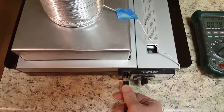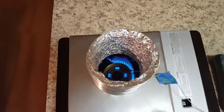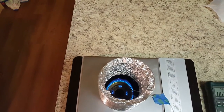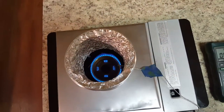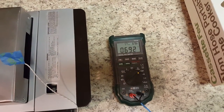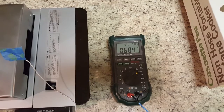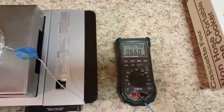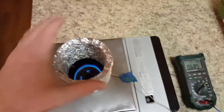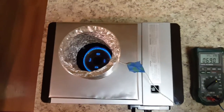The switch is down and the bottle's in. All we do is just turn it on — you can see it starts up and running — then turn it to low. On low, the temperature's coming down. When I started it on high, it went up to about 800 degrees Fahrenheit. Now it's showing 670°F for my little thermocouple right there. That is some good heat coming out of that thing.